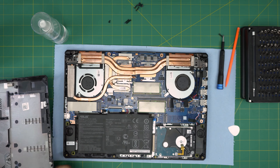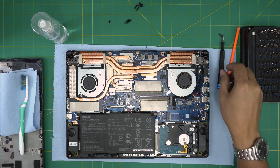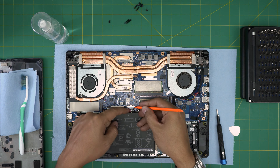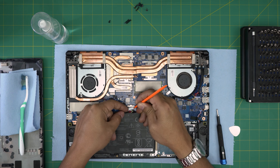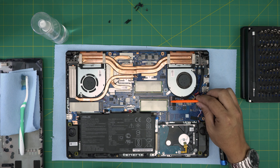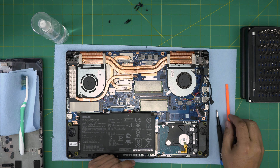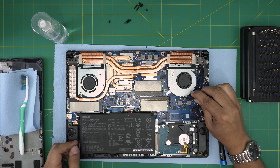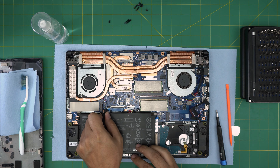With the cover off you can clean up the bottom. Inside, we'll first disconnect the battery — put your fingernails at the side of the connector and pull it toward the battery evenly. Next, remove the flex cable for the LCD: lift it up 90 degrees, pull the jack out, and untangle it from the fan side using tweezers. Pull it back carefully — avoid yanking on the cables.